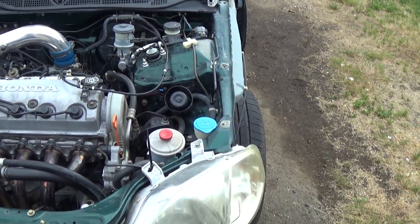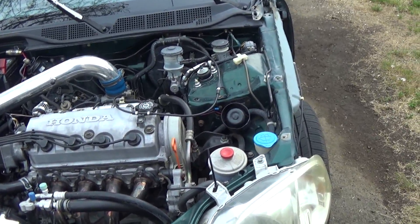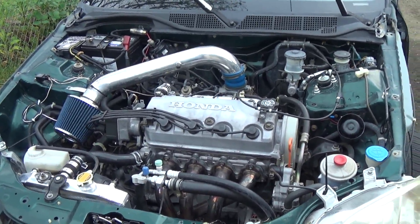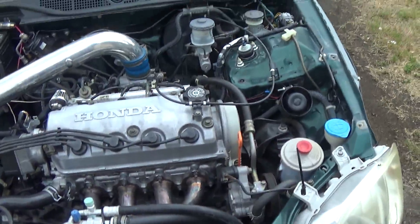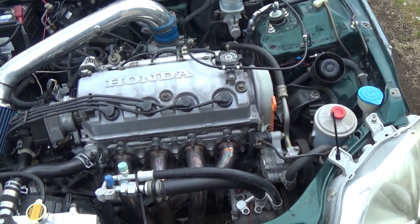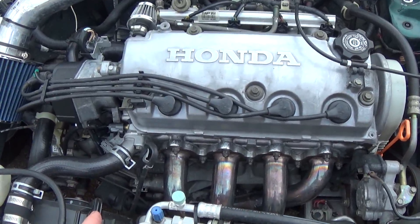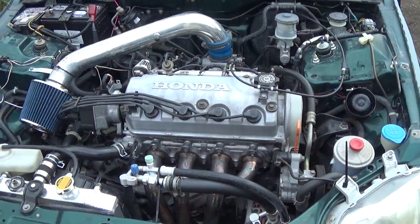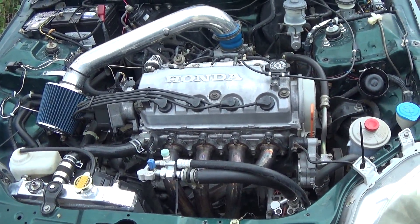Here I am — the car's turning over but it's not starting, I don't know why. I had a bunch of codes, so I cleared them. The next step after clearing is to try to start the car for about 10 seconds, because that will cause codes to reset so you know you're dealing with good ones. I cranked it for 10 seconds — which is a long time when you're not getting a start — then ran the code reader. I actually didn't get any codes except the O2 sensor one, which I knew about. Your car starts in open loop when it first starts, so it ignores the O2 sensor since it's not heated up enough. So I had zero codes, which was a big bonus. I went from having all those codes to having none.